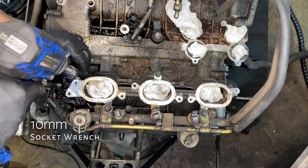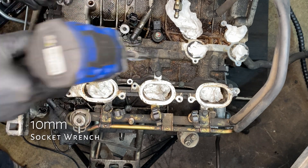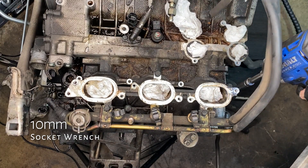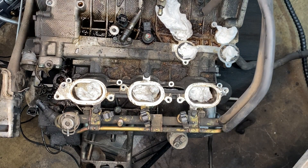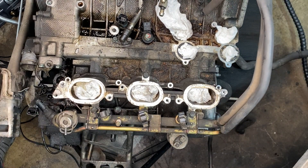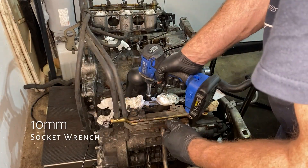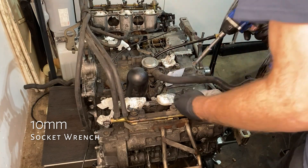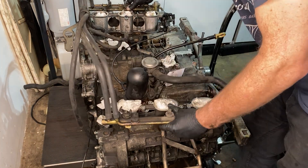The fuel rails and the manifold — I don't actually know what this is called, I looked up all over the place, so I'm just going to call it the fuel rails and the manifold. These 10mm bolts here will take off the manifold on each side, and then that just lifts out, no problem at all. Going over to the other side, same thing again — just a handful of 10mm bolts to undo. And then we're just able to lift that entire thing away. We've got a lot more space now.